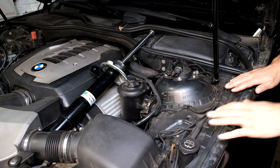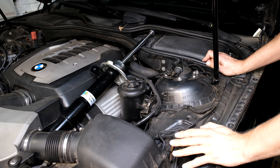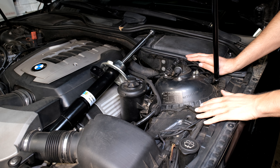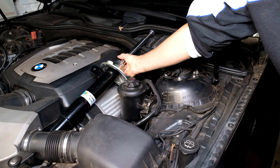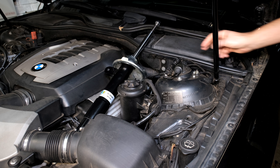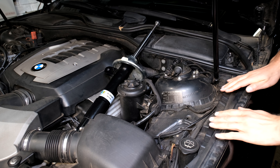If you drive without the EDC enabled it makes a huge difference - it's like night and day. When I disabled the EDC module it's like driving on rocks, never mind run flat tires - it's extremely firm for this vehicle. So I know that when I put the replacement strut and rear shock in, it'll be much more comfortable than driving with the shock unplugged.